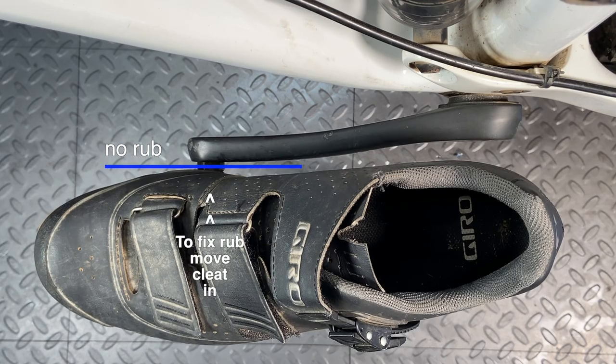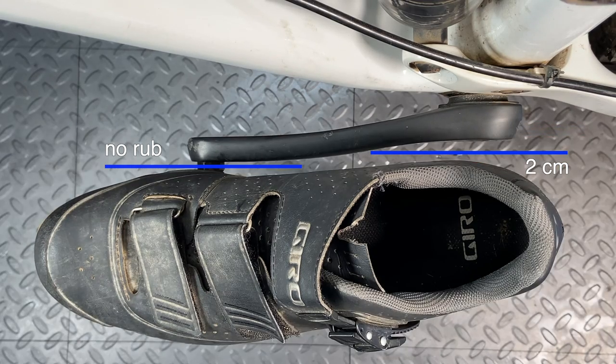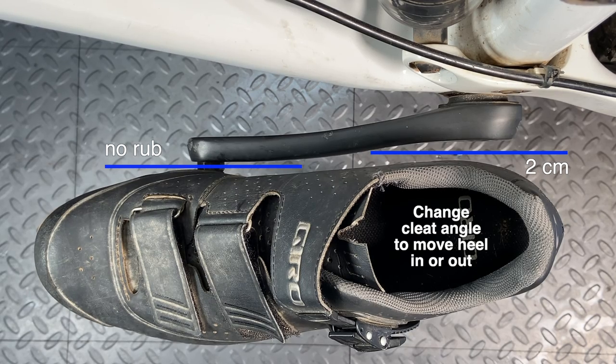If the front of the foot rubs the crank, you'll need to move the cleat in toward the crank. Next, look at the back of the foot to check your cleat angle. A good neutral starting position that works for most riders places the cleats so that there is space between the heels of the shoe and the crank arms of about three-quarters of an inch — two centimeters, or about the width of an average man's index finger. If the cleat angle needs adjusting, note which direction the heel needs to move — in or out — and by how much. It's a good idea to put directional marks on the shoe so when you adjust the cleat position you can see which way to move it.